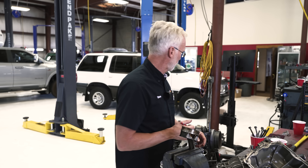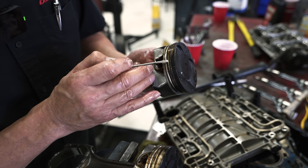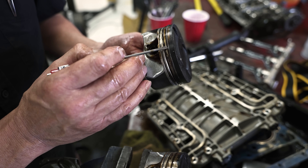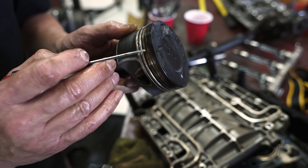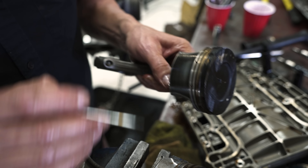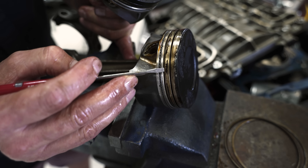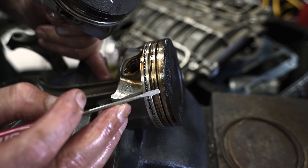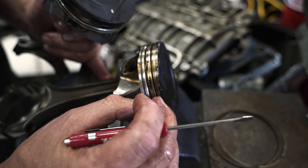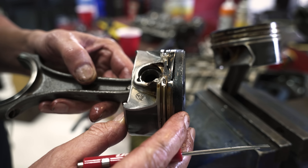It causes an explosion. This is what the explosion looks like - this here is combustion. See this carbon between the second ring and the top ring? This dark carbon right here. You can kind of see where it blew out. You're getting combustion between the second ring and the top ring because oil is coming past that second ring. The fuel droplets combine with that oil and there's an explosion in there that literally blows metal clean apart.